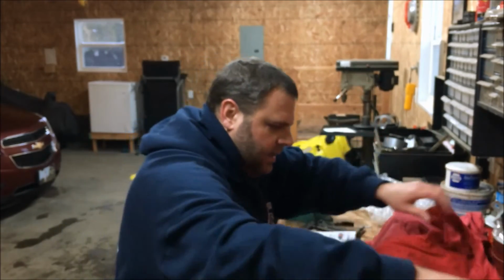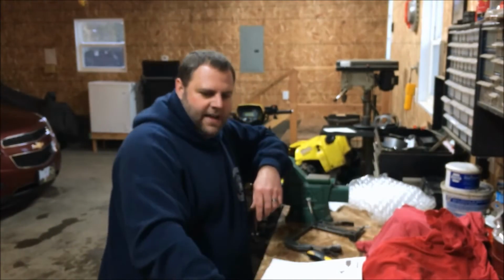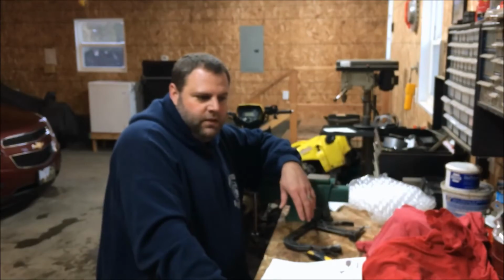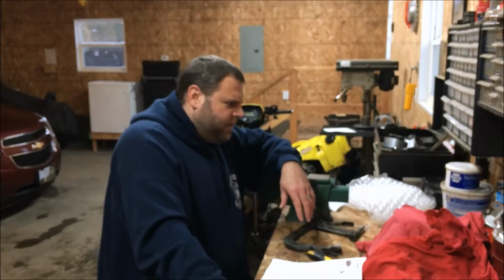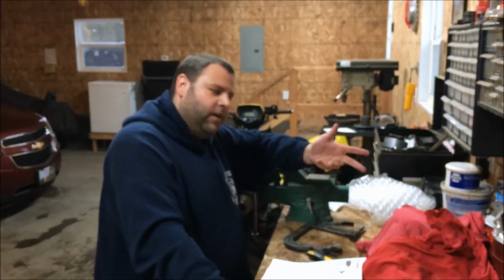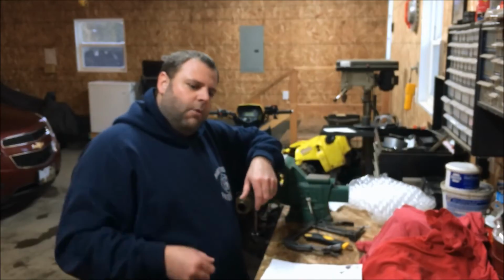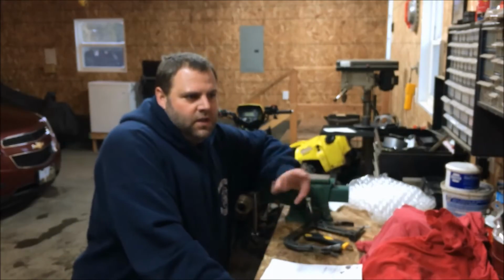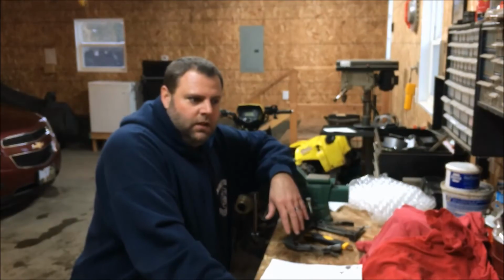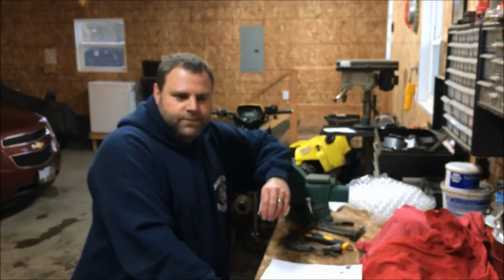But that was just for measuring, like I said. I did order a piston, rings, gaskets, exhaust gasket, obviously the wrist pin and clips. What else came with it? Oh, it came with valve seals also in this kit, but I already bought them separately. I'll put a link to that down below also. I thought it was a good price. It was $180, $185 with free shipping. Just a stock cylinder or piston, 102 millimeter, so it wasn't too bad.